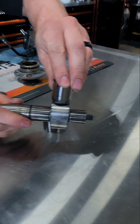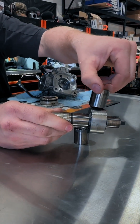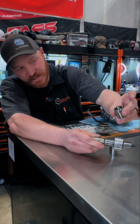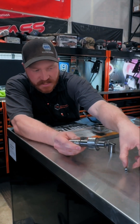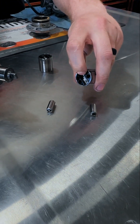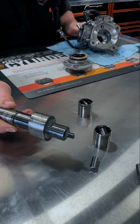They have a lot of spring pressure right on top of this piston, and this thing is supposed to ride like this. Well, sometimes they end up rotating like this because there's no centering pins on that piston. So essentially, they can roll over to the side, or in the case of this one, they did not roll over but twisted. You can see that these don't want to really roll — they've got flat spots in them. They stopped turning, therefore ended up just scraping, and therefore we ended up with a bunch of metal up in this thing.